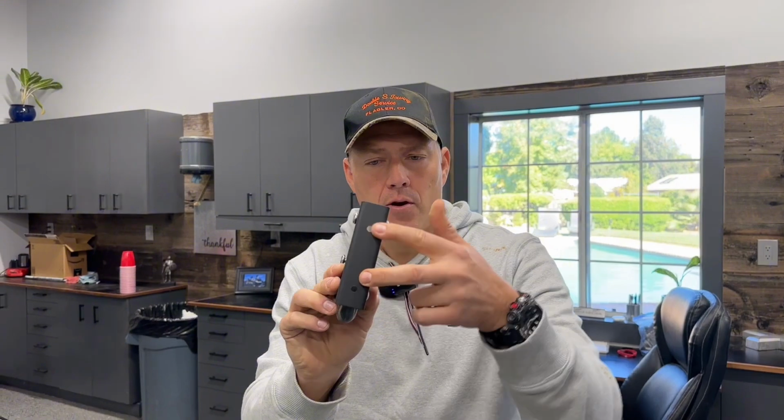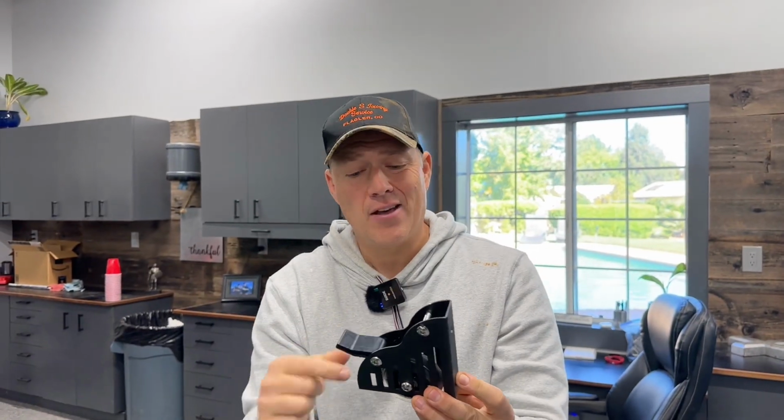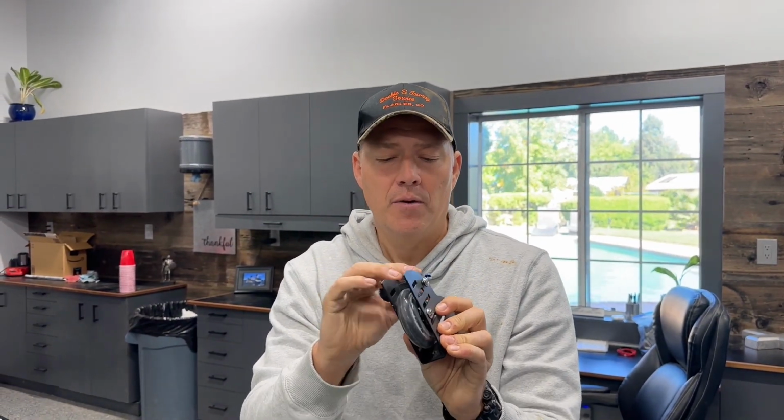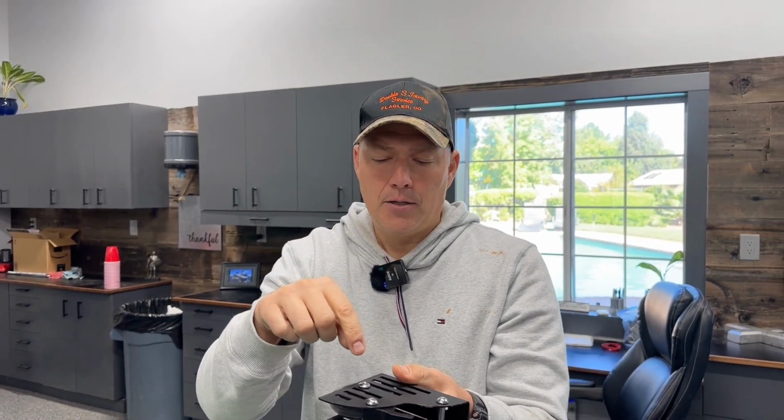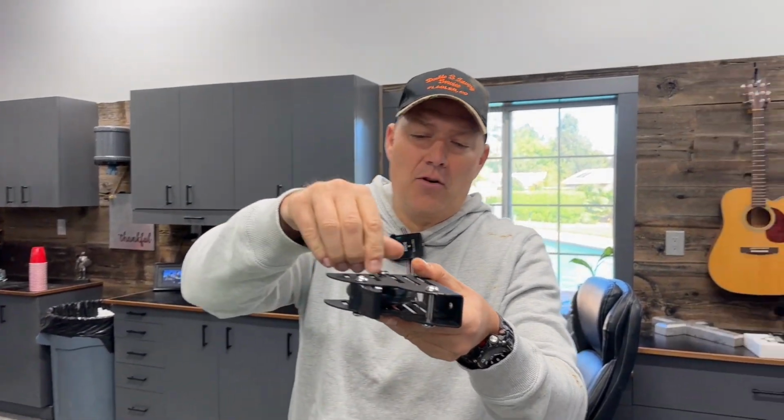But first of all, we want to take a look at the wheel structure itself real briefly. When you're mounting these wheels, there are two holes in the very back that we have to be cognizant of. If you look at the line of where this back hole is, in order for you to get the fastener through, you have to remove this wheel. Now, these wheels honestly remind me of rollerblade kind of wheels. There's two things that have to happen. You have to utilize an Allen wrench or a hex wrench. This is 3/16ths that'll work on it. So you loosen it and then they'll come off pretty easily.